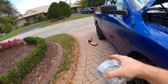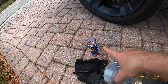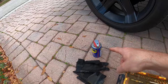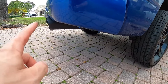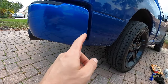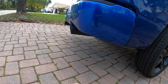We can do this with some simple hand tools. Got some gloves, and WD-40 will help with the rubber isolator — you're going to take off the rubber exhaust hangers and WD-40 really helps get them off. Even though it's not necessary, I'm going to remove my exhaust tips because I don't want them to get dinged up on the bumper, since we're going to have to slide the exhaust system back to get our muffler out. Just two 13mm bolts to pop those off.